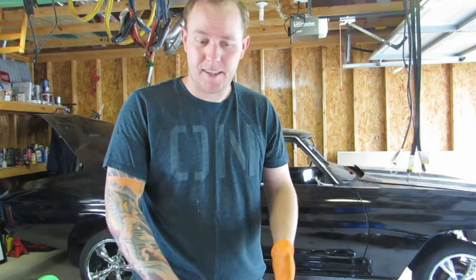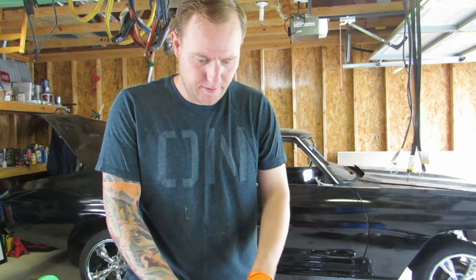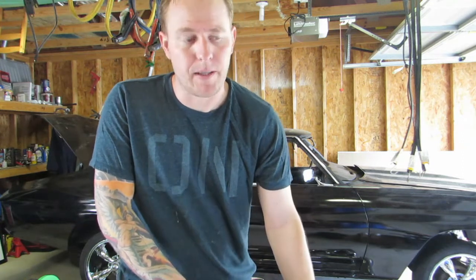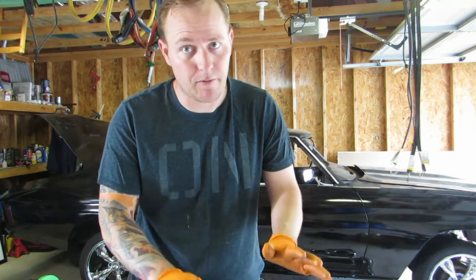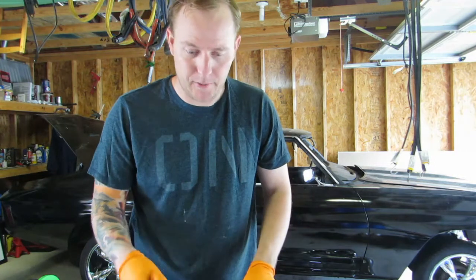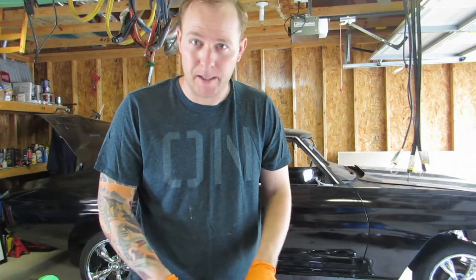Good morning again. Today we're going to talk about rebuilding the engine for this Chevelle behind us. This is a 454, we're going to build a stroker with it. The only reason I'm doing this video is because I couldn't find information about the domes — not necessarily for valve clearance, but how big of a dome can we go in an Edelbrock aluminum head, because I want to save on weight. I don't want this thing diving around corners; we're going to lower it and I want to enjoy it.